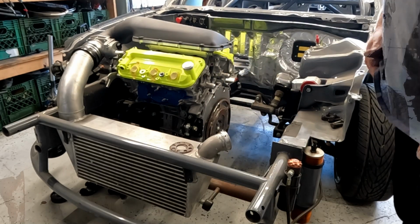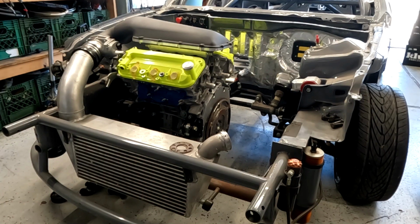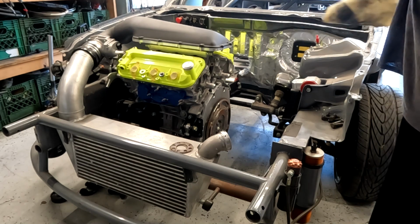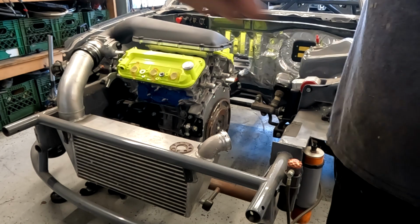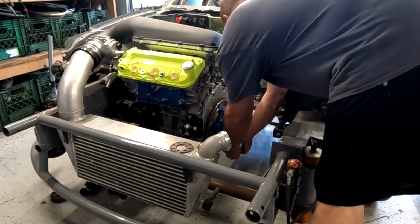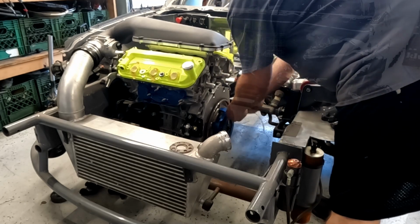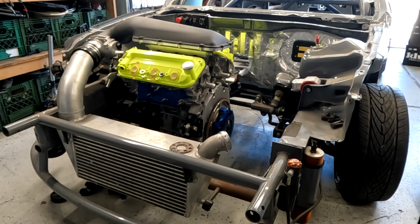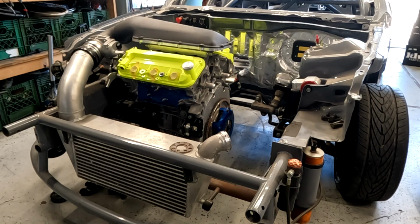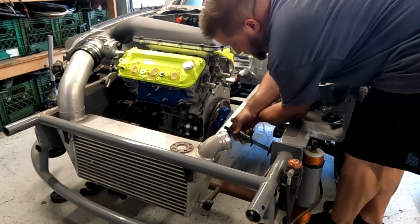Backside looks good. Everything's so gosh dang dirty from sitting. Gonna put the clutch on, not putting any of the frictions or steels in, make it easy. Got our flywheel on, no spacers, and our clutch shell. So a straight edge from this Merc.